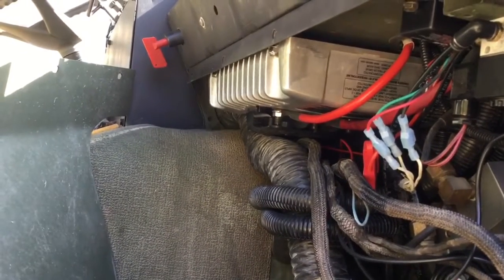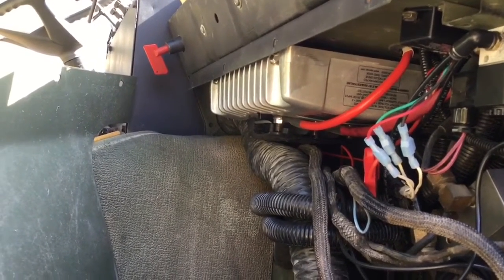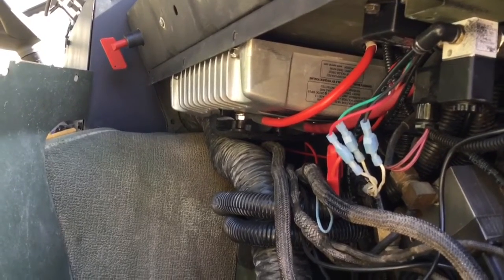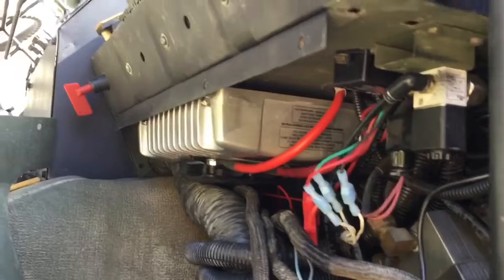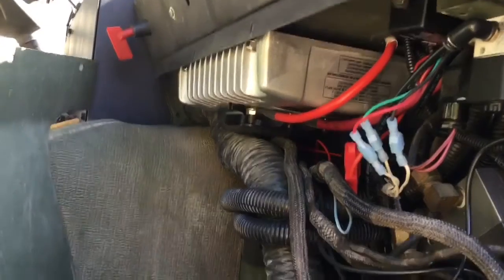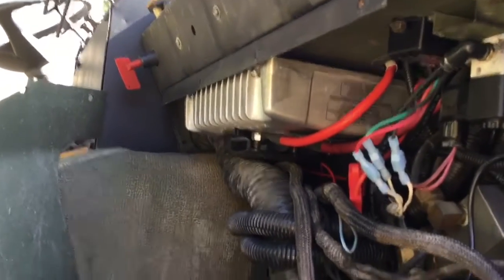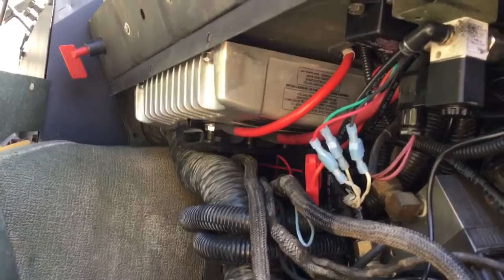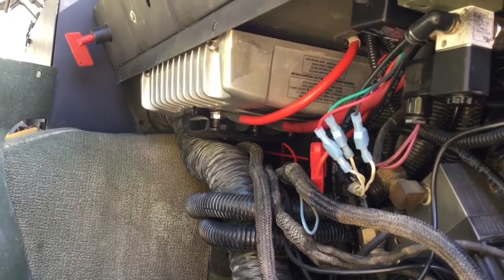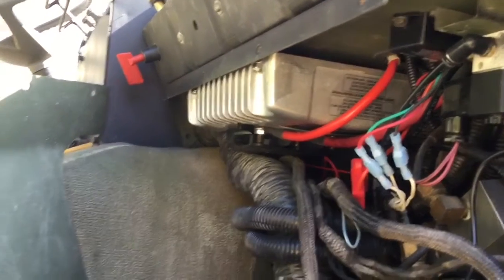What I'm going to do is run a small wire through a couple of inline diodes to knock the voltage down a little bit from the starter circuit, back to the coil voltage — the 12 volts being applied to relay K2. That should keep K2 locked in place during the crank. Once you're done cranking and the load is removed, the voltage should be sufficient to keep the converter online. If not, I can rig a jumper and manually bypass K2 and start it that way — really no problem, maybe just an annoyance.